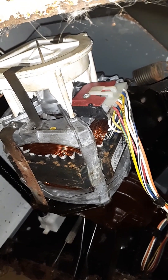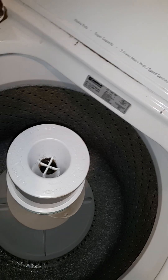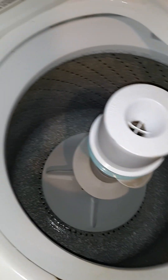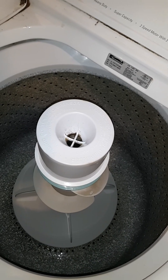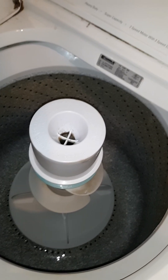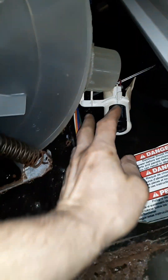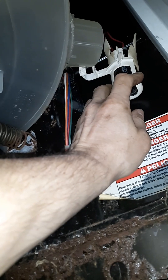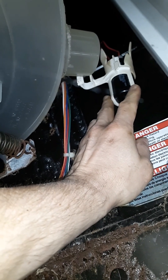We're all back together now, so I'm going to sit this thing back up and see if it works, or if I'm going to have to come back down here and put a new capacitor in. Well, all it's doing is humming and not spinning, so the capacitor must be bad too. Maybe the motor wasn't even bad — it's just the capacitor. I'm back under here. You can see the old capacitor, so I just have to get it disconnected from the wires and hook the new capacitor up to it, and then we'll try again.